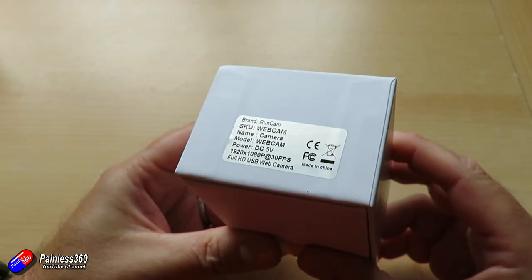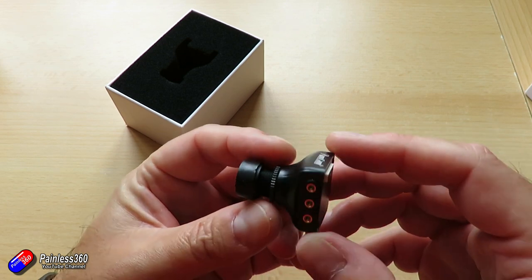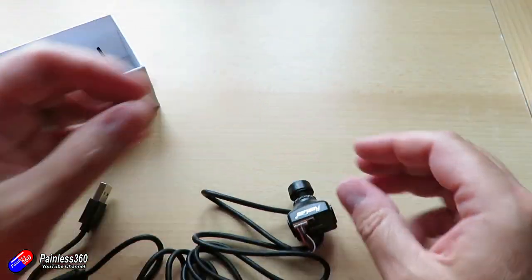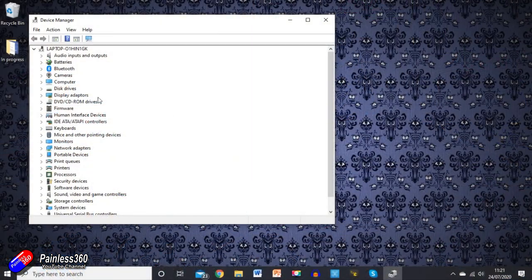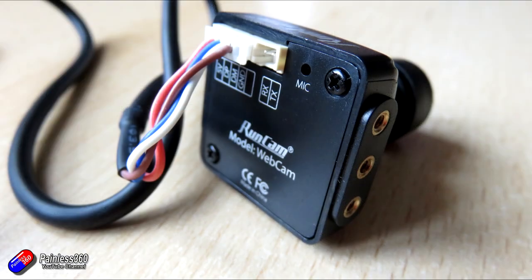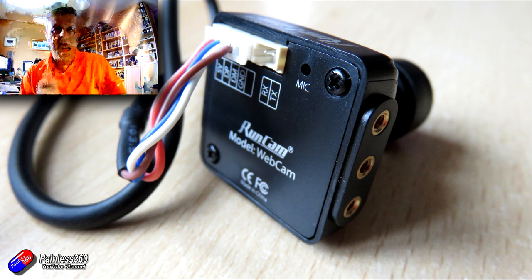The last one I'll talk about is this thing here — believe it or not, it's a webcam. This is a first from Runcam. When you take it out of the box it looks exactly the same as an old-style FPV camera, but the connections on the back are very different, and it comes with a USB cable ready to plug into the computer. Plugging it into a Windows 10 laptop seems to work very well — no need to download any drivers, everything's automatically configured, and both the microphone and the camera itself appear in Device Manager without you having to do anything. The microphone can be a little bit quiet so you'll need to play with the levels, and on slower laptops it occasionally had some breakup issues, so be aware of that if you have an aging laptop.